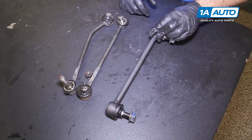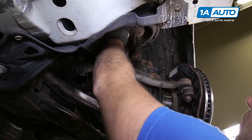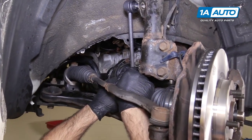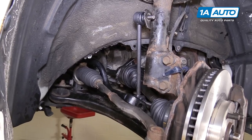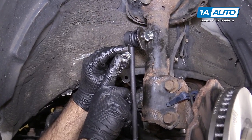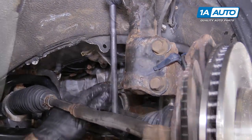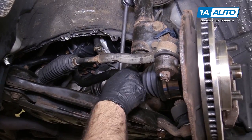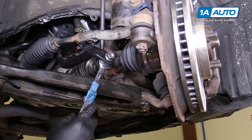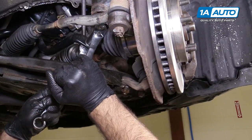So this should fit great and work great in your vehicle. You can bend these around and slide it through. These nuts are locking nuts — the hole is not perfectly round, it's kind of oblong, so when this starts to tighten it will lock and it won't want to back off. These nuts are 18 millimeter. The counter hold on the back is also 18 millimeters. I'm going to use a deep socket, 18 millimeter in the front, to get these snugged down, and I'll come back and torque them.